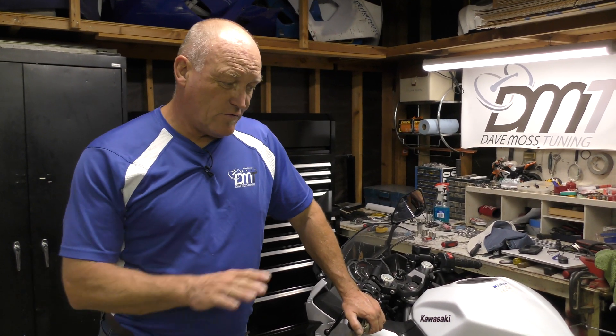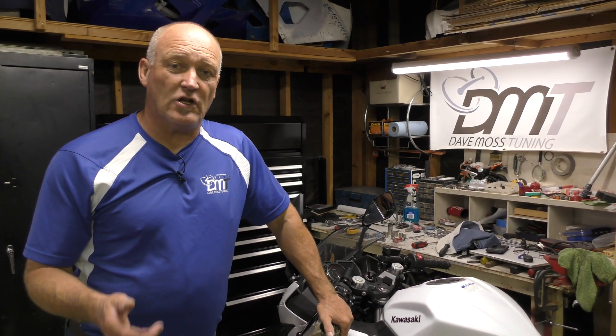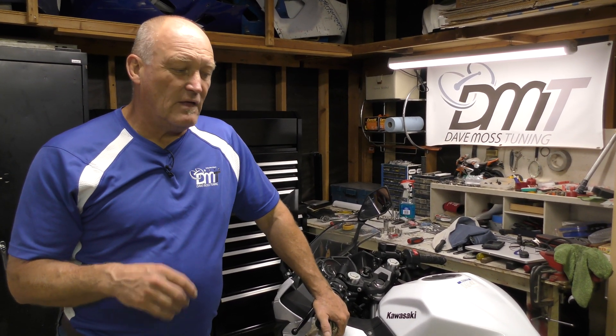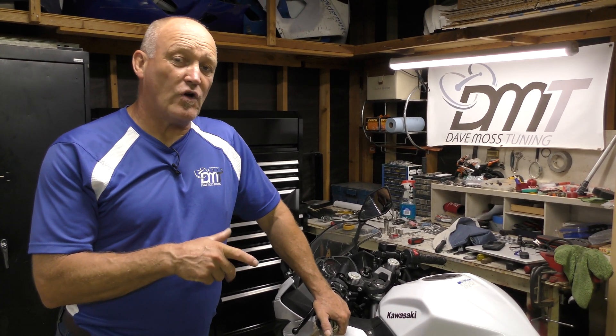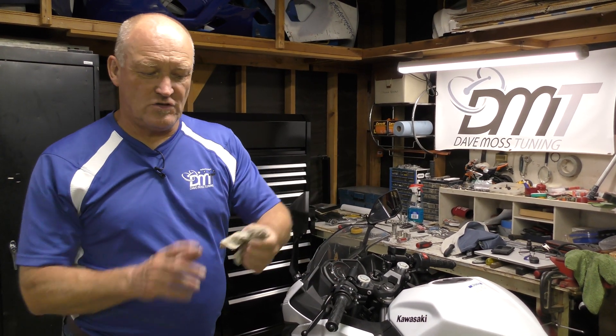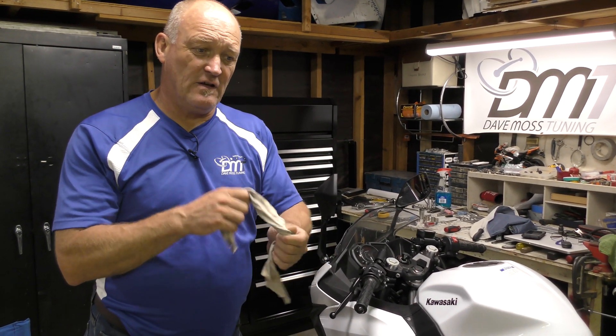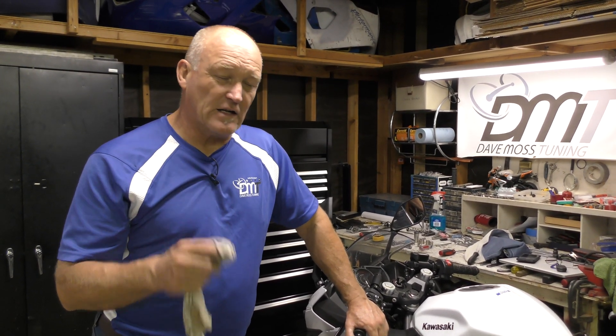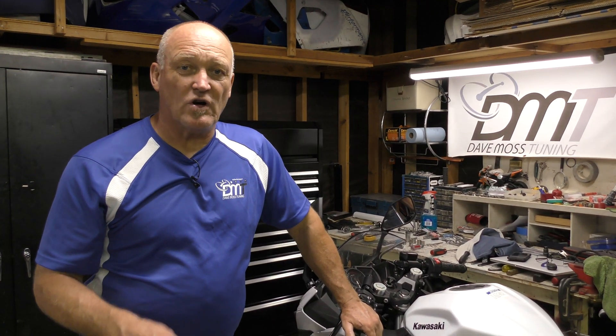Once all the testing is completed, you don't want that grease to stay on there because it's just going to collect a lot of dirt, rocks, and debris — things we don't need on a chrome shaft that cannot get scratched at all. After a few hours of testing and filming, we're going to go ahead and wipe it off. If it's tight or difficult, you can use some Q-tips to take the bulk of it off, or use a strip of rag around the shock shaft to wipe it all clean. Give it a few days, and if there's some residue left you might see another ring — go ahead and clean it again, getting as much off as possible so we don't score the shaft.